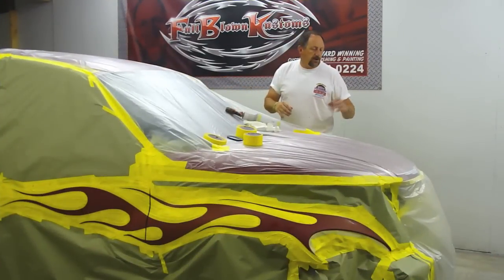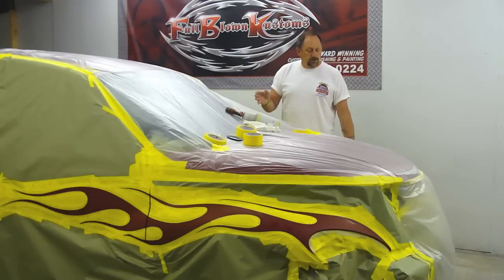From this point, we've got about six hours into the job. I went ahead and took the bumper and headlights out, door handles, mirrors. We've laid out the flames and masked everything up. Now I'm going to mix up a fine silver — I'm not going to use a coarse silver. I'm using Diamond Paint on this one. You don't have to put sealer down on this OEM finish — this is just a standard OEM finish on a stock car. Basically what I did was sand it with 600, scotch-brited the edges, used wax and grease remover and water-based cleaner. Now I'm going to go over it one last time, check all the edges, make sure everything's down good, spray probably two coats of silver until it's covered, and then go back and do the beveled edges.